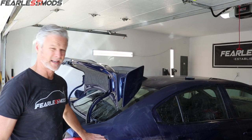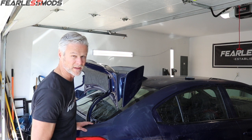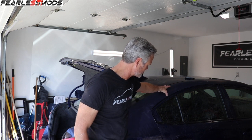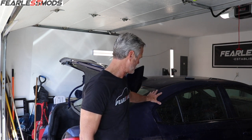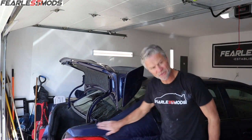There are a couple of areas where I'm going to be sanding close to things I don't want to damage, so I am going to put some tape around the lights and some of the trim in certain areas. It's going pretty good. I did notice a spot right up here where it looked like I was starting to sand through — kind of a light blue stripe right there. I haven't sanded through; for some reason I just didn't get good paint coverage right there and it's lighter. Everything I've sanded feels much smoother so it should buff out real nice.